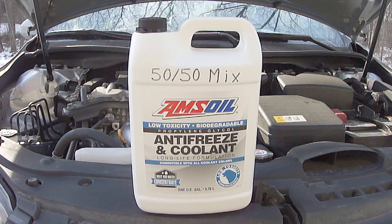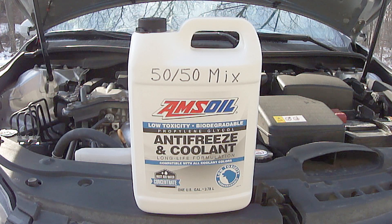Filling the cooling system with more engine coolant is a good place to start to check for leaks. If you do find that the water pump has a leak, be aware that there are no products out there that you can add to the engine coolant that will permanently fix the leak. You need to replace the water pump as soon as possible.